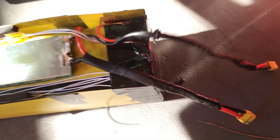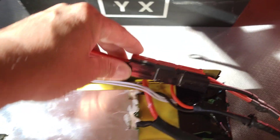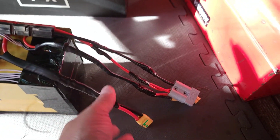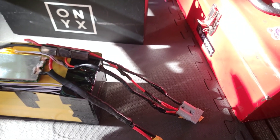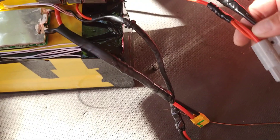A better way to do it is to leave your discharge side and charge side both connected, and use a completely separate harness connected straight to the battery terminals. That way you'll have an extra power wire you don't have to use all the time. When you're just riding around normally and don't need all that power, operate off your normal discharge power cable. If you're going to race and need maximum power, use the cable going straight to the battery. That's the best approach.